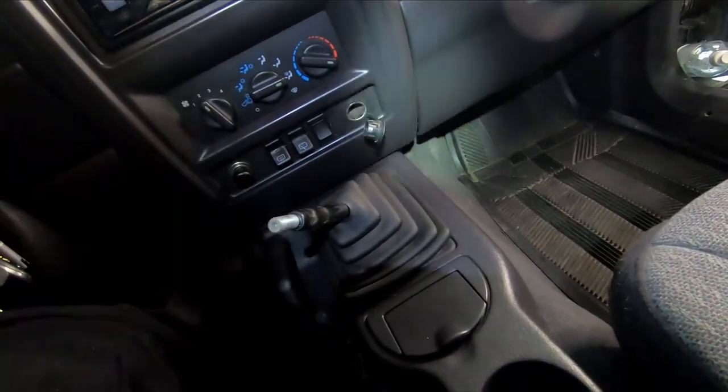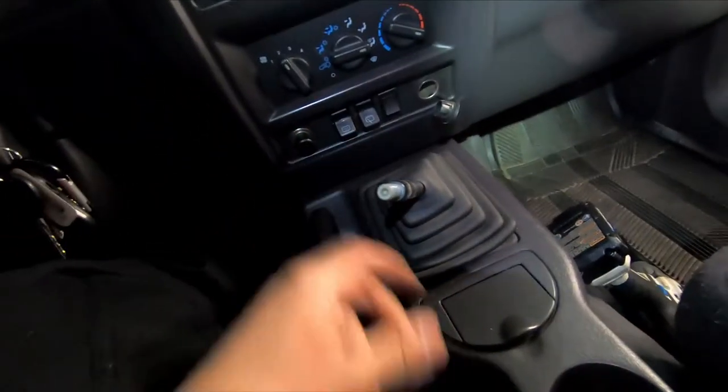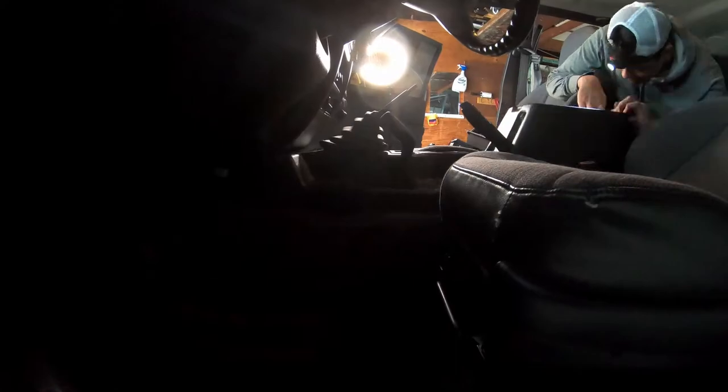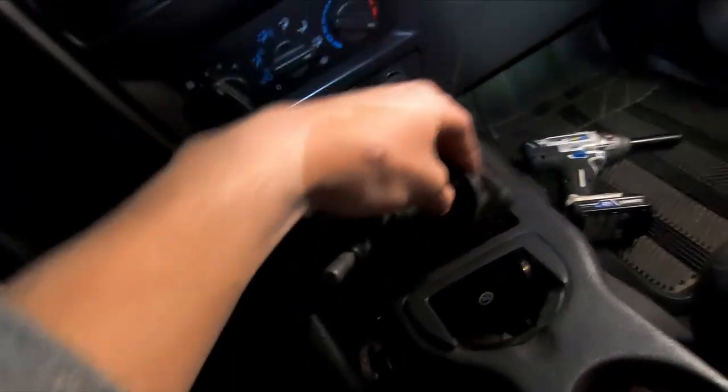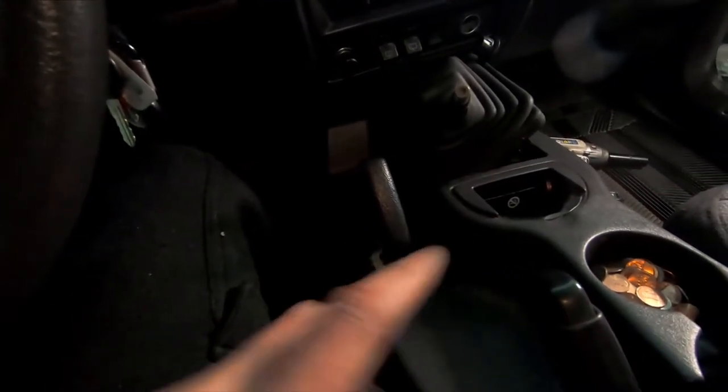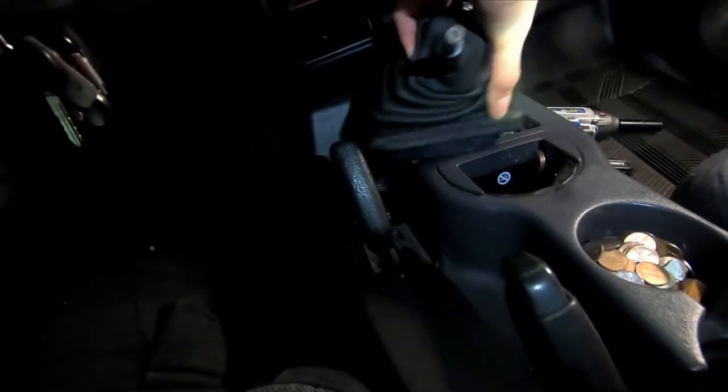Some models have an impact nut on the bottom, so just pay attention. For this one it was just that one single nut. Now, there are two things you need to know when removing this: there's a bolt that screws on to this side right here, and then there's another bolt — you have to lift the boot out to see it. Make sure you take those two out because if you pull too hard you'll snap the plastic and end up with a wobbly center console.